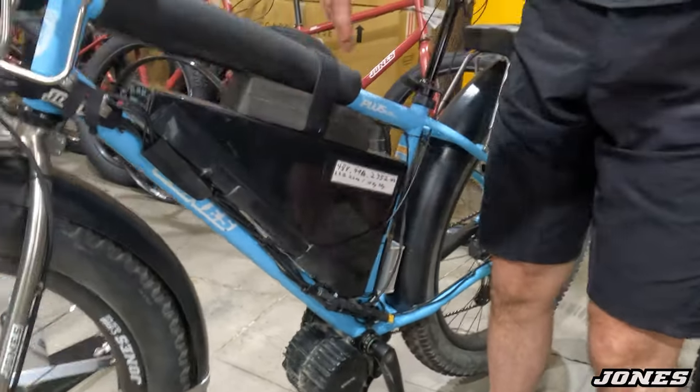This battery pack has 49 amp hours — it's a big pack. We have two sizes of battery pack in this style. This type uses a key so you can lock it on, and it slides off the frame. We have these in 10.4 amp hour and 17.5 amp hour. There's also a super long range option. Running a name brand cell is a good idea — everything I've seen says they're much better than a standard generic Chinese cell. That's why I spec this with Samsung cells: Samsung cells, 10.4 amp hours, 48-volt battery pack, 500-watt-hour. This is the same size as the Bosch 500.